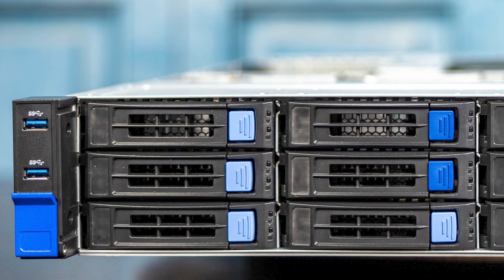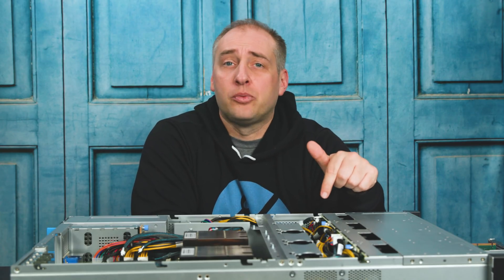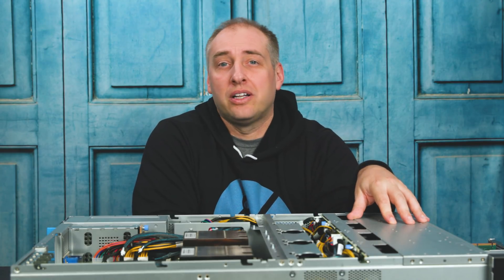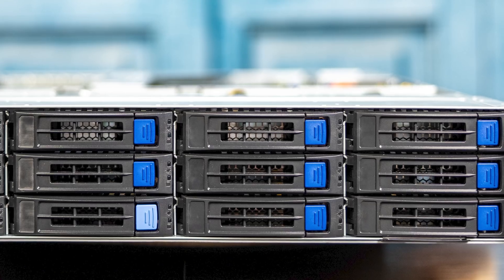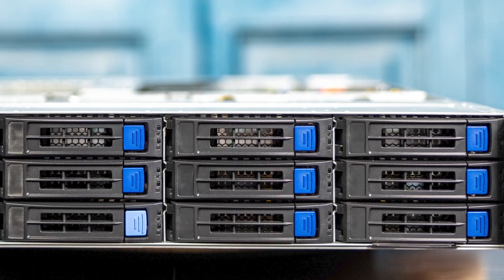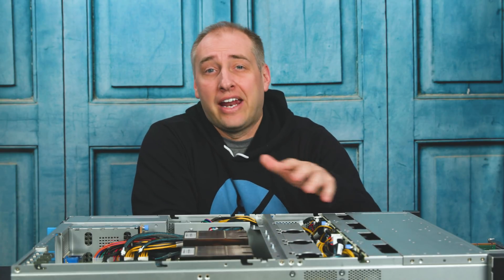The other really big feature on these front panel drives is that four of the drive bays can actually be NVMe SSD drive bays as well. There's wiring on this backplane and through the chassis to bring PCIe lanes to the front of the system. We were able to get Kioxia CD6 drives as well as Samsung 1733 drives to link up at PCIe Gen 4 speeds up front — that means you get an absolute ton of performance out of those four drive bays, while still getting eight three-and-a-half-inch bays for hard drives. Building all that flexibility in means we have a lot of wires going to the back, because both the NVMe and SATA data paths have to happen, as well as power.